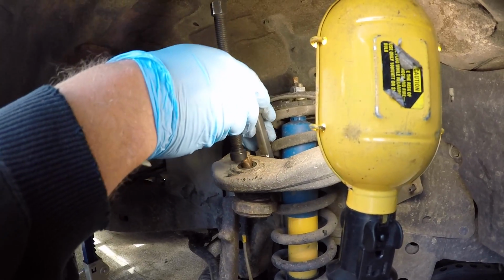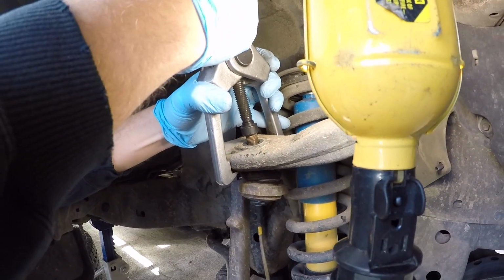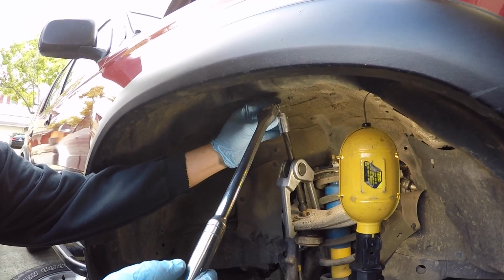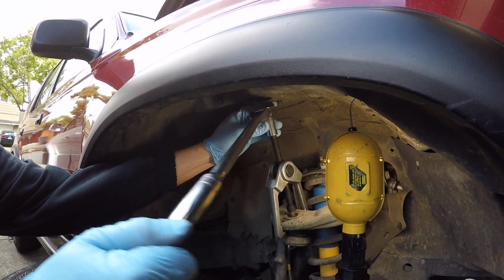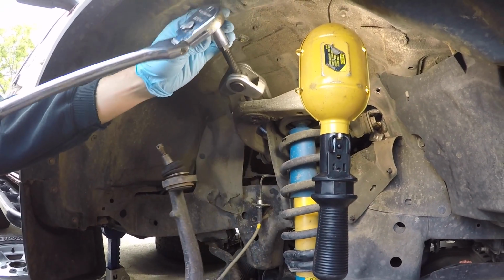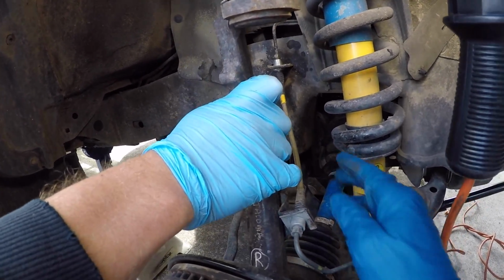So Jordan's going to capture the edges of the upper control arm in that fashion. One arm near the spring and the other arm facing directly out towards the tire. For this particular puller, it needs a 16mm socket or open end wrench or box end wrench to turn it. So he's just getting on there with a big 1/2-inch drive ratchet, 16mm socket, just putting pressure on the top of that spindle till it gives. Just like so.